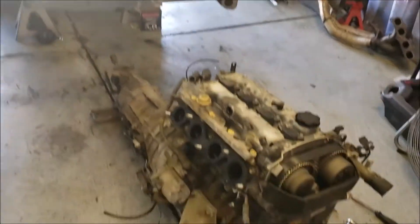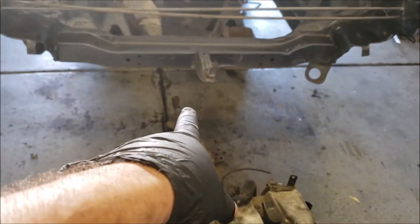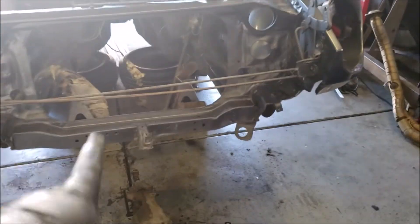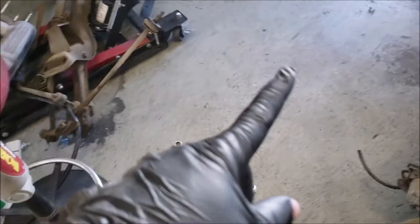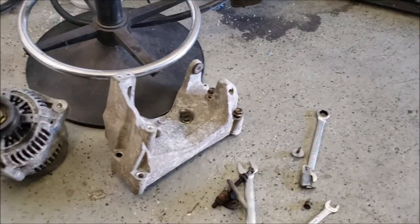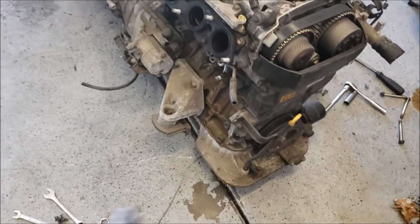As far as placement goes, pretty much wherever the center of the transmission shifter is going to be, that's where it's going to be set. Then I'm going to figure out what I need to do about making motor mounts. Also the alternator bracket right here - it should fit between the rail but it's pretty hideous just to hold an alternator. They do make a low profile alternator bracket that hugs the block a lot more, so I'm probably going to get one of those.